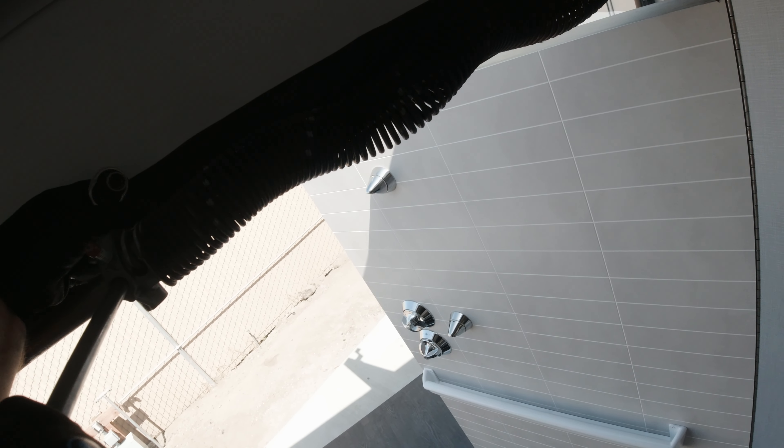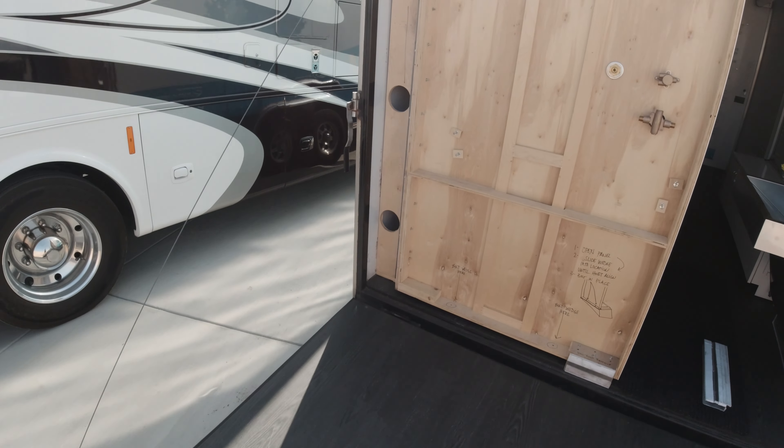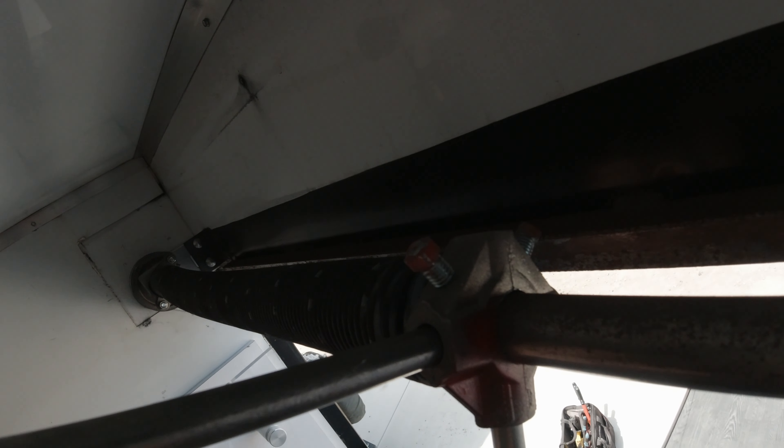We've taken off the tension to both torsion springs here. Now there's one pro tip that we didn't carry on to this situation — that was releasing the tension to the torsion springs and just sustaining them with your torsion bars. The reason I didn't want to do that is because we're dealing with a toy hauler and a very different type of configuration. So I almost want to start from scratch. Starting from scratch will allow me to get a good lay of the land on how the tension to the springs is working with the cables — because we don't want that ramp to be too heavy, we don't want it to be too strong, we just want it to be just right.